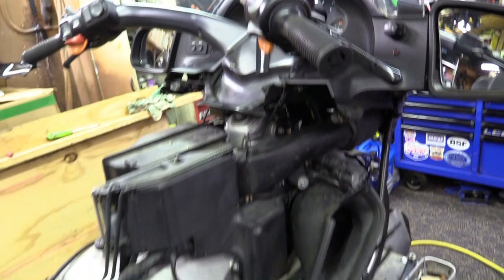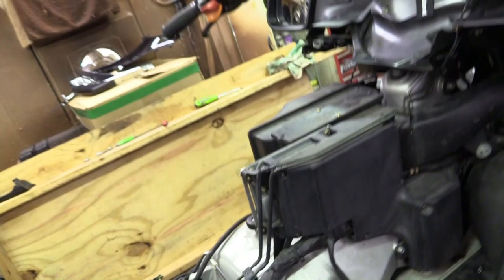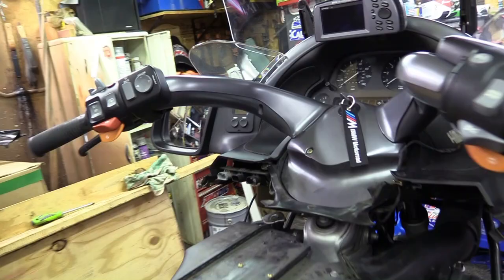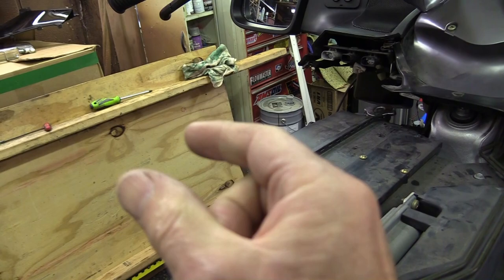That micro switch will also activate the brake lights, and on the rear brake you've got a little micro switch down there too. So where they tend to go wrong is the micro switch that's attached to your throttle. On your throttle bodies over on this side of the bike there's a very small micro switch that when you rotate this backwards, you can hear a very quiet click.